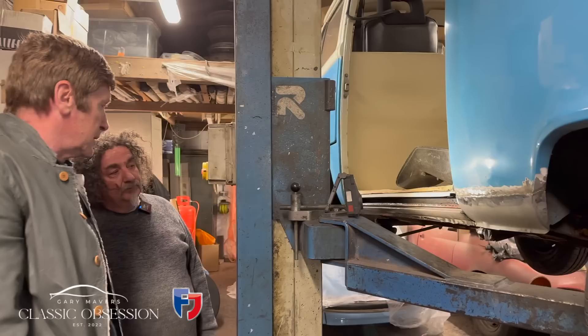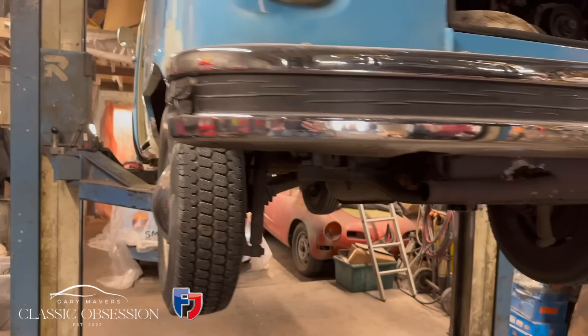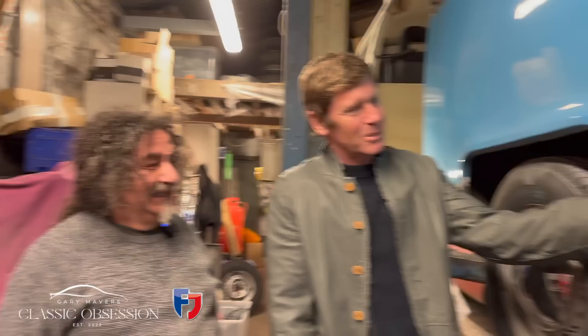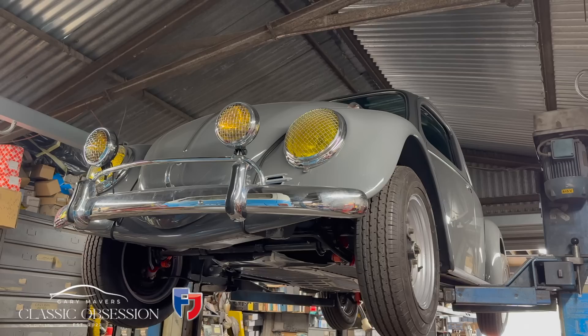Looking at the van in progress: new in and out sills, wheel arch bottoms, belly pans to change, front wheel arches, and door skins — it's a well-used van. A repair piece has been welded in over the rust hole, with a little bit of filler before carving it up and getting the shape right. Nearby, a rally cross Beetle belonging to their windscreen fitter has had its chassis restored, with another garage doing the body work before coming back to be finished off.